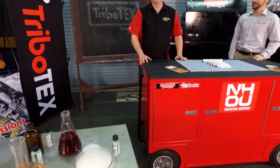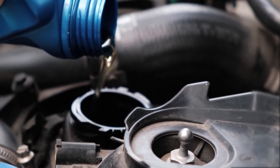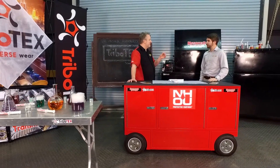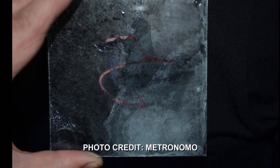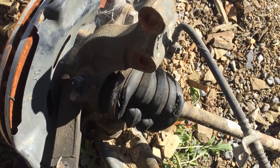There are a ton of additives for your car, engine, and transmission, and it's hard to tell them apart — but Tribotex really stands out. It will stay in your engine longer, it will not break down components like your catalytic converter, and it doesn't use products that would be removed from fuel. Some lubricants like molybdenum disulfide (MoS₂) are great in short-term applications in clean oil, but in long-term use they can break down into corrosive materials. Molybdenum disulfide is a great lubricant; however, if it reacts with water and oxygen, it can form molybdenum trioxide (an abrasive) and sulfuric acid. That's why it's important to check your CV joints and ball joints for cracked boots — if water enters, that MoS₂ can break down.